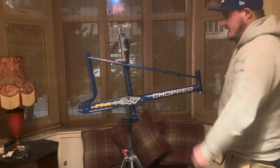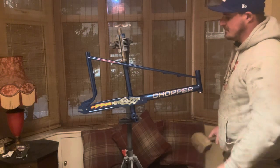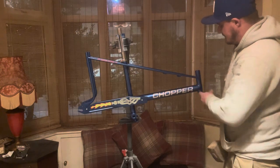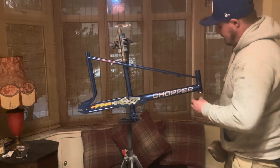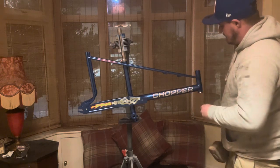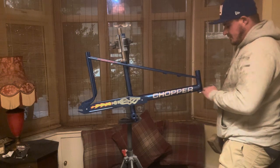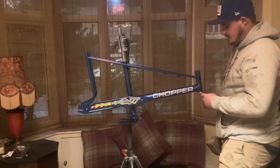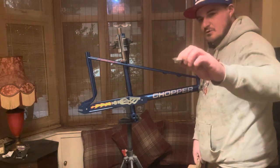I did make that mistake many years ago. I did my first restoration. I was probably 12, 13. And I think I put the cup upside down, smaller one on the bottom. Soon realised when I put the top cap on that the bearings didn't work. So yeah, your bigger one goes on the bottom, unless you don't remember when you've stripped it down and are rebuilding one of these. But your bigger one goes on the bottom, and then the smaller one goes on the top.